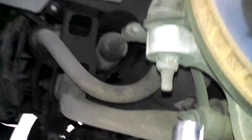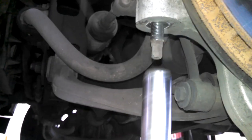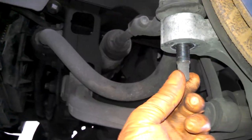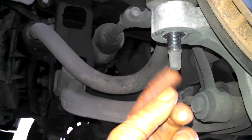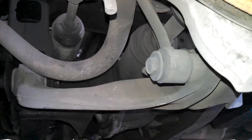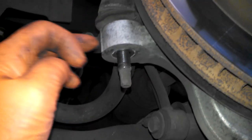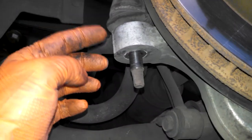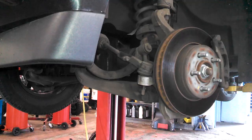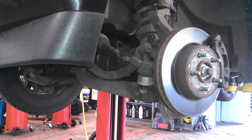I'm going to go ahead and take this tie rod off here. It's a 10 millimeter socket that'll fit on the end of this if you have a problem taking it off or putting it on. Hold the ball joint in place. We'll give this a couple love taps on the side here with a hammer, and it should separate that. Try to leave the nut on the bottom in case you miss and hit the threads somehow, and you can protect the threads with the nut.